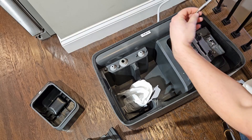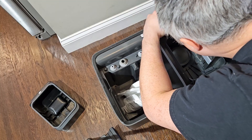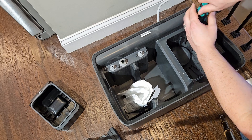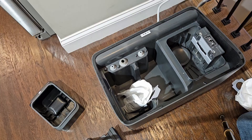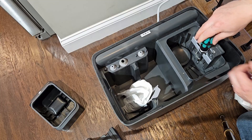We're going to take these screws and put them back in their original holes. Remember, turn them backwards until you hear it click because you don't want to thread it twice. I heard it click, and then we turn it forward. Don't over-tighten or you will break the plastic. Do not use a drill for these because you can't get the feedback you need for putting plastic screws in.